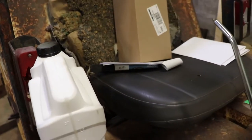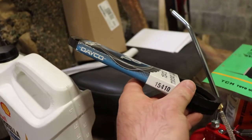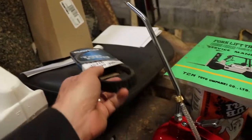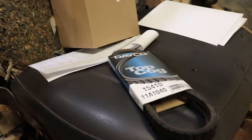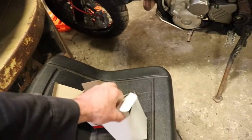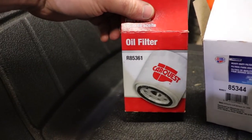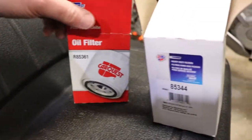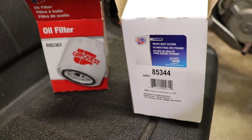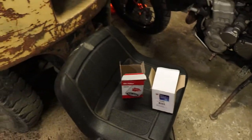I've got a belt here — hopefully this one works. I just looked up a Nissan H20 and hopefully that's the right one. The two spin-on filters have different threads on them, which is good. This one is for the engine oil and this is going to be for the transmission. They're very similar looking but they don't interchange, so you don't need to worry about mixing them up.